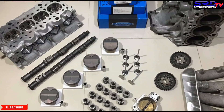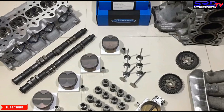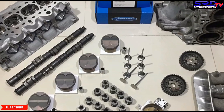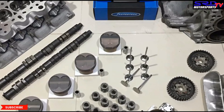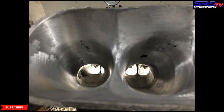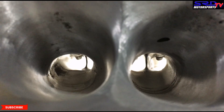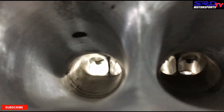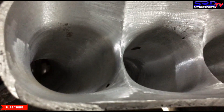For those wondering if we're sharing all our secrets — everything we share is just 20% of what we know. The other 80% is proprietary. That's our secret to going fast. Now going back to this: it's a 4-in-3 runner on the edge near the cam gear, and then 1-in-2, port matched really well. Here in the video you can see there's some dirt on the intake manifold because we haven't washed it yet, but we just wanted to show you how consistent the taper and the porting is — and this is going to work so well.